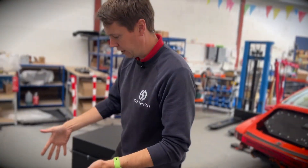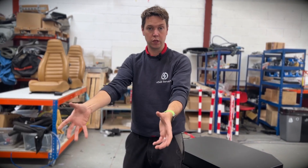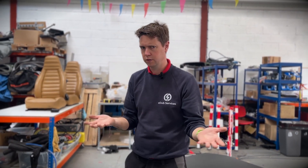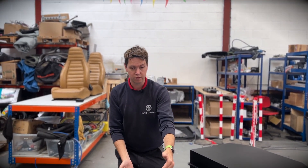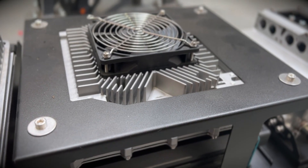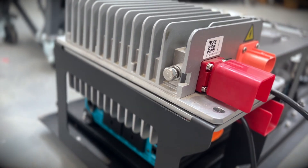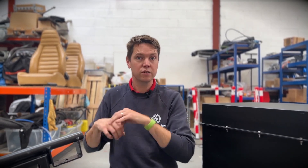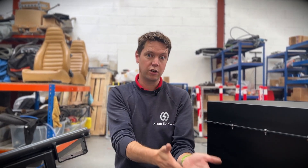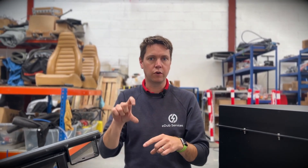This shelf here is what goes on the petrol tank shelf. If you're familiar with camper vans, they have the main engine bay, the gearbox that normally sits between the rear wheels, and on top of that is the petrol tank shelf — that's why we call it that. We now fit a lot of our other items on here. Specifically, we have our motor inverter, which takes DC power from the battery pack, turns it into AC power and sends it into the motor. We also have our charger and our DC-DC converter, and in this particular system an inverter for off-grid camping. The DC-DC converter is effectively your alternator — it takes high voltage power from your battery pack and, just like an alternator, turns it into low voltage power for your 12-volt starter battery.